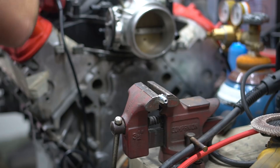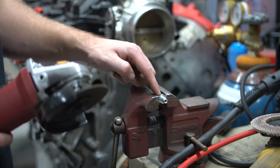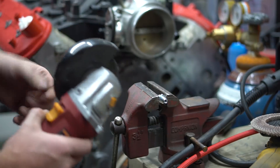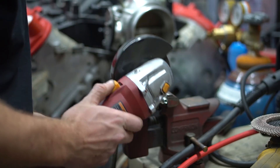New plan — I found this fitting that threads into the steam port on my radiator, so I can run just a dash-3 AN braided line from here to the rad. We're going to cut this with enough room to get some weld in there and then weld it on.